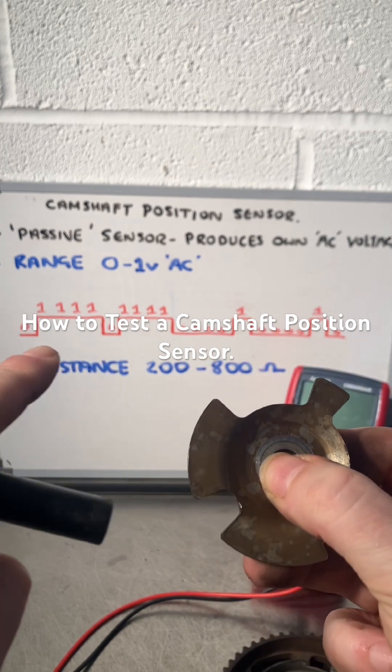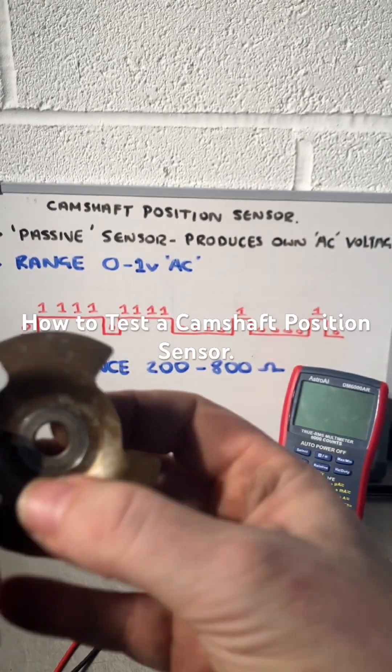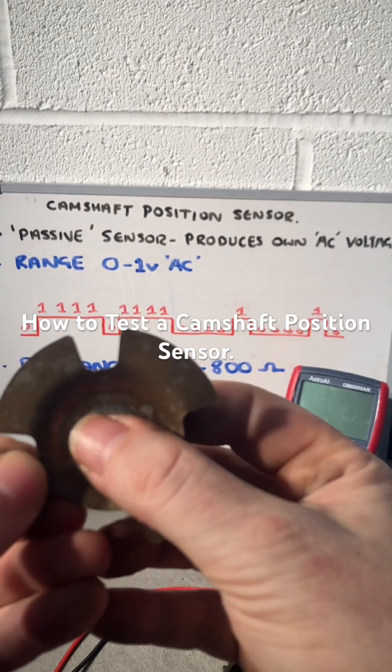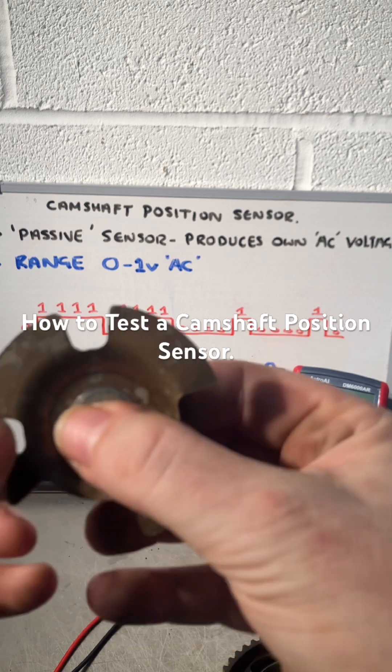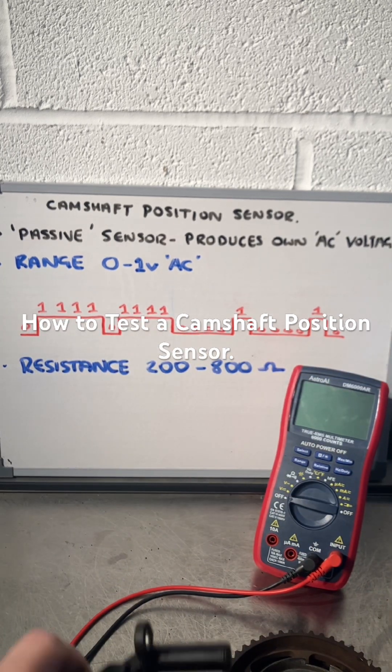As the sensor goes through the magnetic field, it creates a back voltage that then gets converted into binary — as shown on the board. A high point would be one volt, so in binary that's a one, then a low point is a zero, then a one, and so on. From that, as I say, it can deliver the right amount of fuel to the right cylinder at the right time.